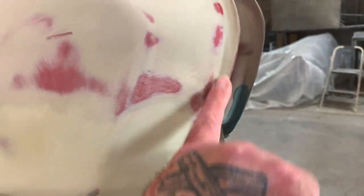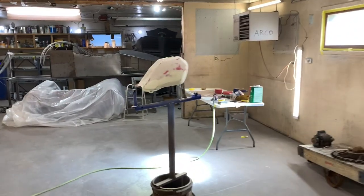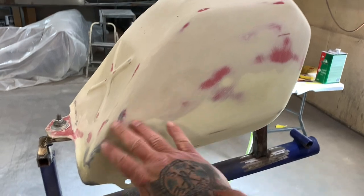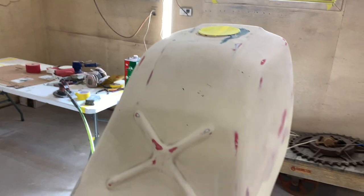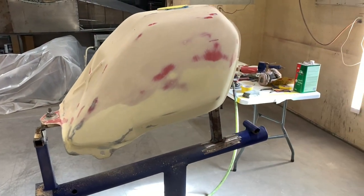Right here you can see the edges, and the inside of the tank is dry with that sealer. I was going to show you guys the can or the brand from that stuff I was talking about. I was talking to DG Retro Customs - he was asking what brand that sealer was for the tank. If I find it in the garbage can I'll pull it back out and show you guys. Anyway, I'm going to be spraying Tamco primer on this - it's a high build primer - so I can get this thing blocked out.